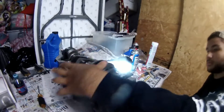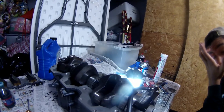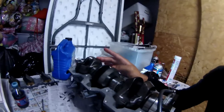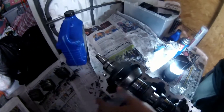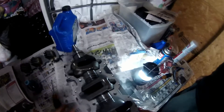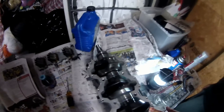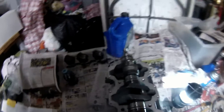Do you feel any roughness? Rotate the crankshaft until number one crank journal is at the bottom of its stroke. The number one crank journal — that's the bottom of its stroke, so that's the top of its stroke. I believe the bottom is right here like this, because it's the deepest that it can be. So the piston will be at the bottom right now. Okay, so let's grab piston number one.